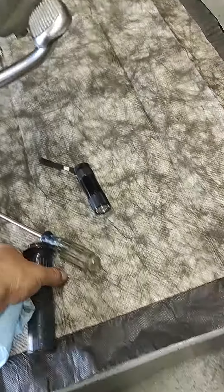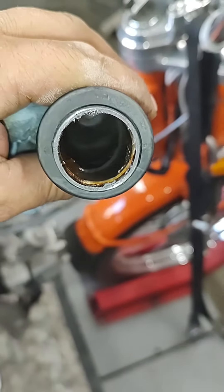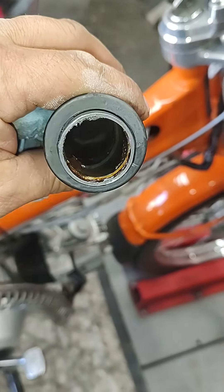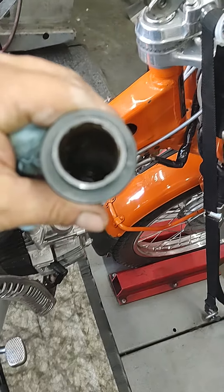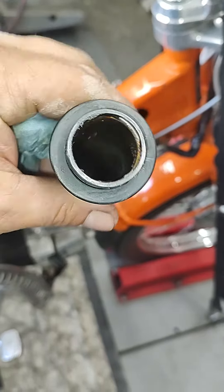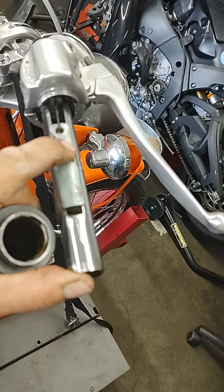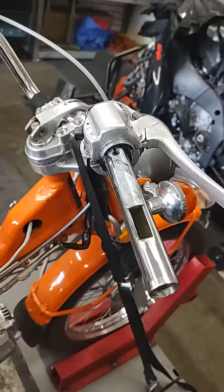You can see there's a little groove in there — that little track right there. That track spins around all the way down, halfway down the dip. What it does is, when you twist the throttle, it pulls this slide over, which pulls the cable.